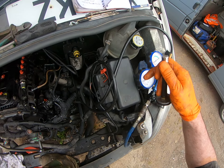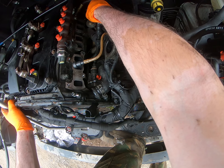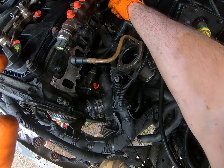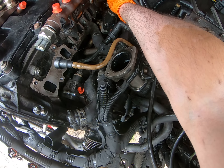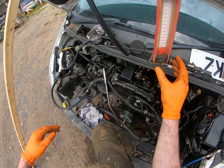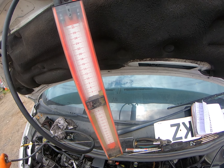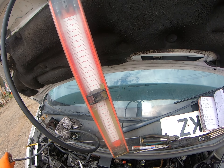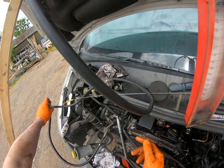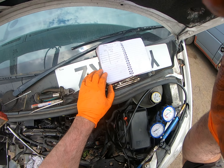We're not getting any leakage — this is a good cylinder. We'll put the little whistle test over the inlet port. We've got no whistle there, no whistle there. Then with the manometer plugged into the crankcase through the dipstick, we're measuring four millibar in the crankcase — that's air just leaking past the rings, which you'll always get. So we can record that figure: four millibar on cylinder four crankcase blow-by.